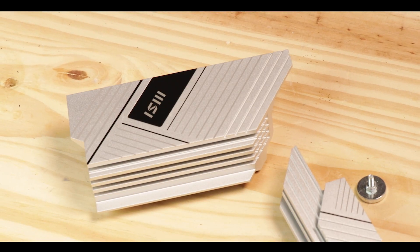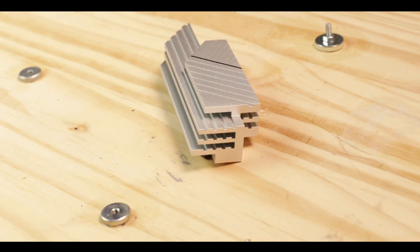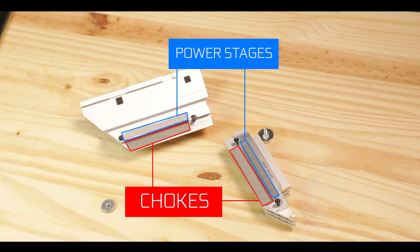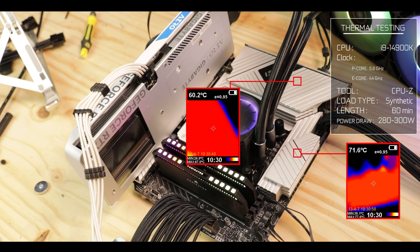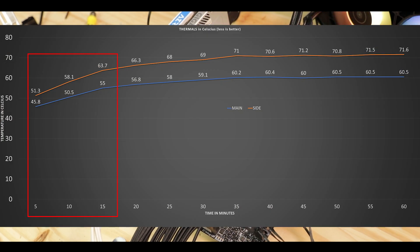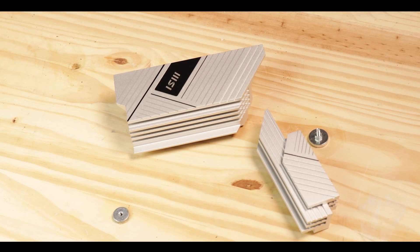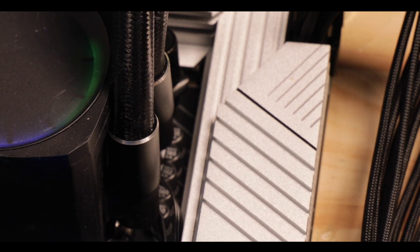The main heat block shows off an impressively large heat plate for extended heat dissipation, and the side block is dense, heavy, and spreads several protruding wings for additional radiating area. Both feature a direct contact design offering direct heat relief to both chokes and power stages. After an hour-long stress test using the most heat-intensive processor on the market, both blocks absorb most thermals in the first 15 minutes and plateau around the 35th minute. The side block runs about 10°C higher than the main block, but we remain largely below the 75°C limit — definitely on the hotter spectrum but nothing concerning.